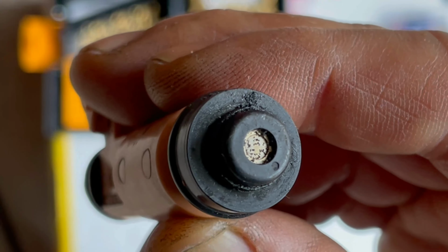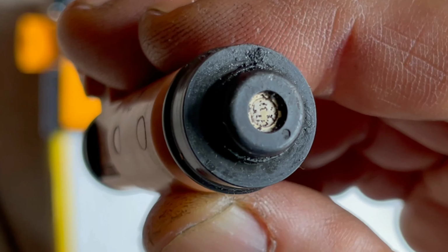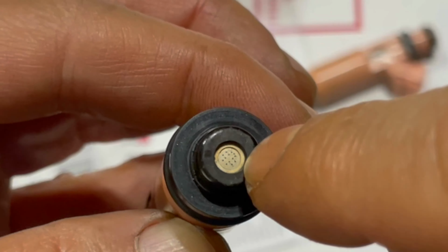As you can see, the fuel injector tips were pretty dirty, and some of the tiny holes actually could be partially clogged. So I had ordered a fuel injector flush kit, but the delivery was delayed. So I tried to rig one up, and it almost worked, but the force of the spray was just too hard to keep the aperture in place, no matter what I tried. But it did help to clean the fuel spray outlet areas, but just to be sure, I did some additional fuel injector tip cleaning. Look how clean the fuel injector tips are now.